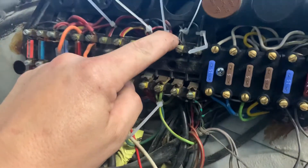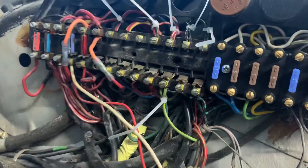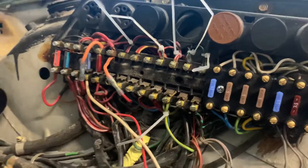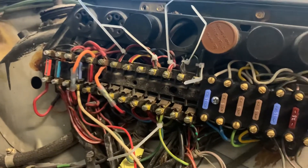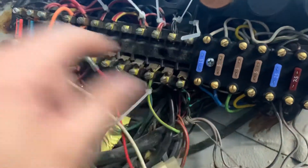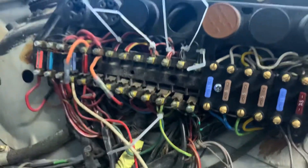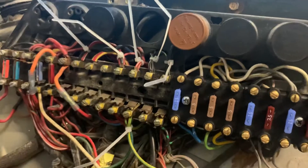This one is gray with a black stripe, and if you leave that out and find it kind of hanging back in there, you go, 'Oh goodness, which one does that go to?' and you start digging out the wiring diagrams. Fortunately for this '78 we have all the factory wiring diagrams, but you still have to trace it — figure out what fuse it is, what wire it is, where it goes. So doing the little bundles saves you a ton of time. It takes a little time to snake the wire tie under there, but it's super easy to swap once you do.